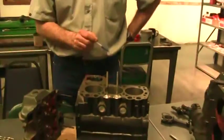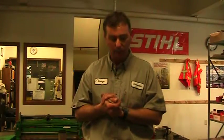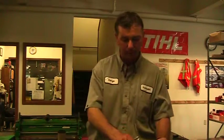The easiest thing to do is cut the 45 a little bit more. When you cut the 45, it's going to grow towards the outside. So we'll cut it with 45. If we need to, we'll do a 60 to bring the middle in, but we'll try just taking a 45 to it and go from there. Okay? That's not everything about valves, but it's a good start and it's a good launching into that. So that's chapter 5.